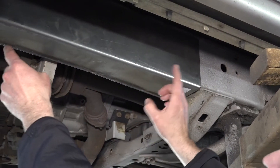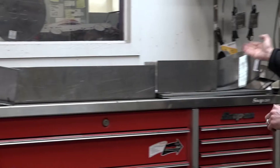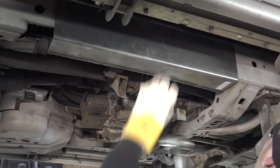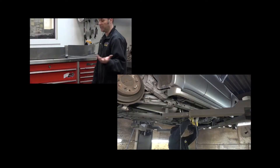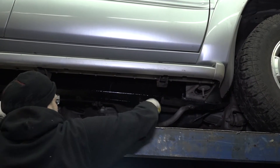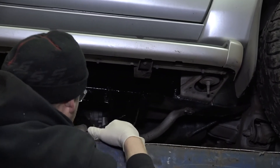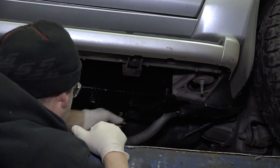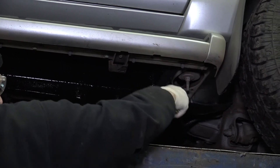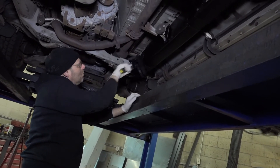You can see how the kit fits perfect. This is the center section, and what we're going to do now is weld it solid. Then we're going to move up to the front — you can see how this is curved and all the mount cutouts are there. We engineered these so they fit perfect. Basically you'll get a new frame out of it when we're done. After our installation, we did the ART 200 up in the front, the ART 201 center frame going toward the back, and also the ART 202 where the rear trailing arm is. So this one had three different kits installed.